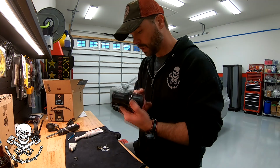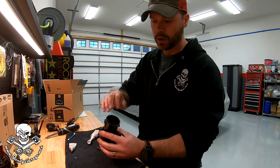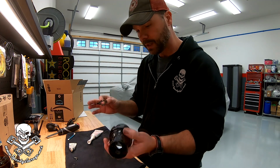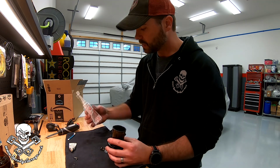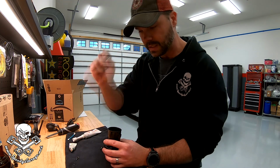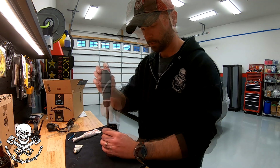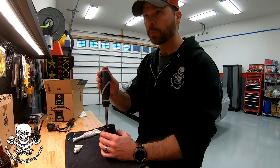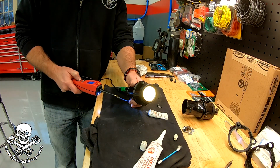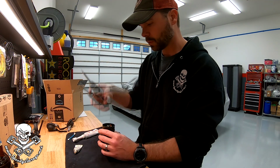But go ahead and reassemble the old lights. I did put some dielectric grease all on the inside, just a light coat on the inside of the housing as well as where the bulb goes through, and I put a light coat on the little backing plate. I don't know if it'll help, but it certainly can't hurt. It does say right here on it, prevents corrosion. So maybe it'll help us. And I also put some anti-seize on the little Torx bolts before I'm gonna put them back in as well. We're just gonna reassemble it. And I did go ahead and connect up my power probe and make sure that me painting the housing and putting some dielectric grease on the parts in here didn't affect the functioning of the light. I want to make sure it would still ground and all that. So I did double check that, so we're good to go there.